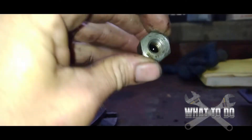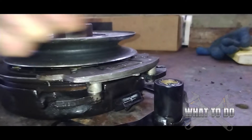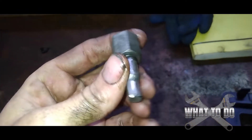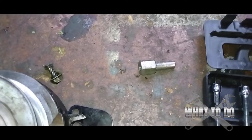That's how you replace this pin, and that's probably one of the problems you're having if your bracket is breaking or your clutch keeps coming loose — check this little stud. It should be easily found online, but I have a spare one and I'm taking it off another machine. Hopefully this helps somebody out. Please hit subscribe — I do videos somewhat daily, and I'll see you on the next video. Thanks for watching.